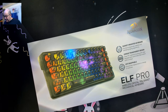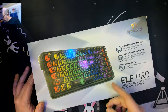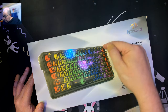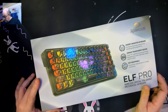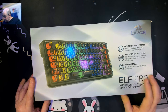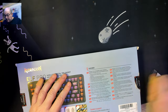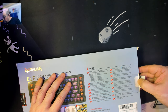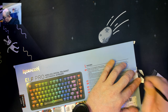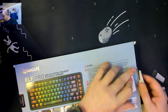Today we're taking a look at the ELF Pro. It is a 75% without a knob, which is almost rare nowadays because so many keyboards just add a knob and/or a screen. It's a regular 75% with a slightly exploded arrow cluster and navigation row. It's got clear PC keycaps, is hot swappable, uses a transparent PC plastic material with clear keycaps and clear switches, and like the regular ELF, this one is also a gasket-mounted keyboard — one of the first few from Red Dragon. It also has a polycarbonate plate.